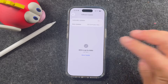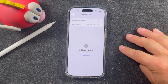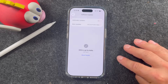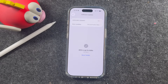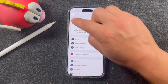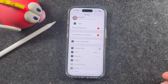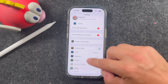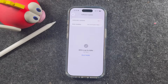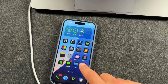This is how you update your iPhone and install iOS 26. If you ran into any trouble — like you're not seeing the update or it's failing — sometimes you may have to restart the phone. You can also try logging out of iCloud, log back in, then restart the phone, and then go back down to General and try to run that software update. That has worked in the past with some errors.